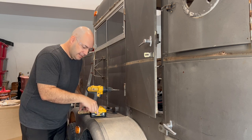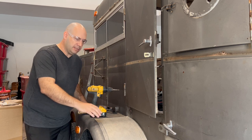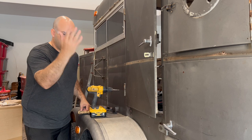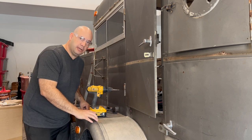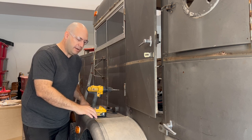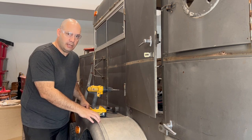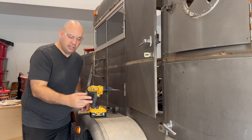So let's get to drilling out these rivets and removing some of this trim. This applies to basically all the trim, especially this flat trim on the trailer. Save your trim because I'll also show you how to renew that trim in order to use it again — to either reinstall it where you took it off or in a different location if you need to use a piece.